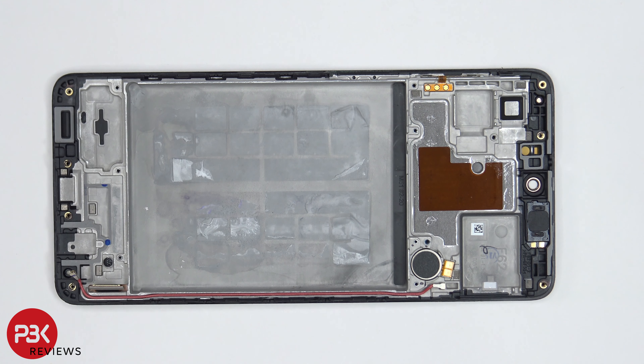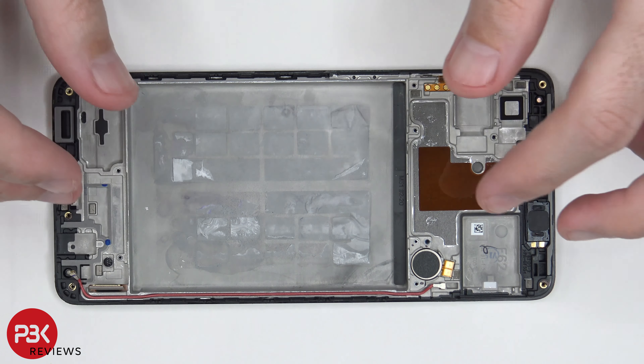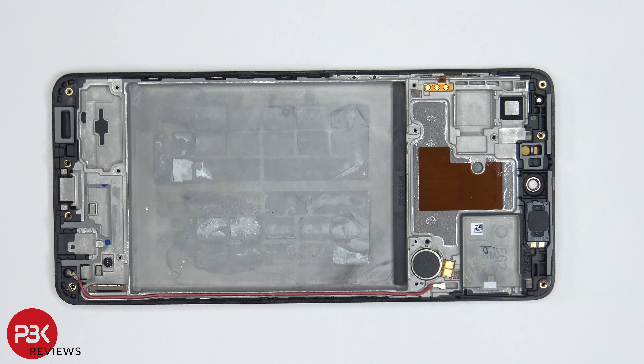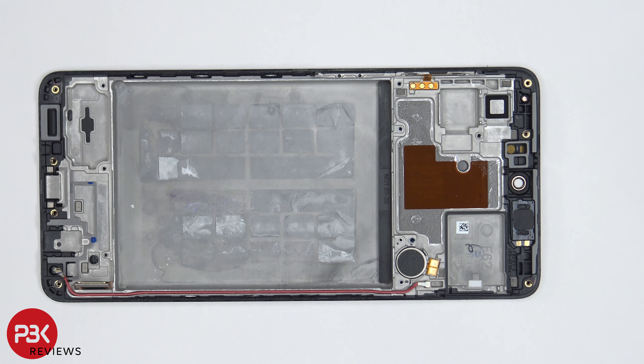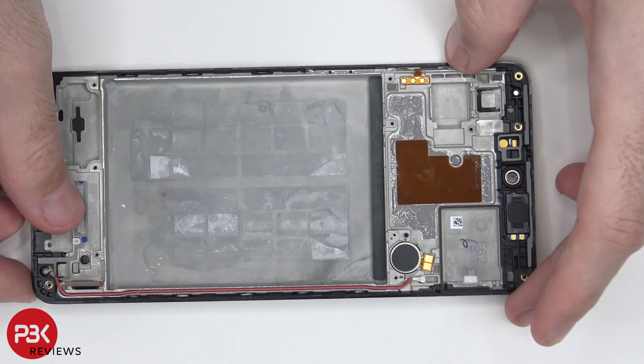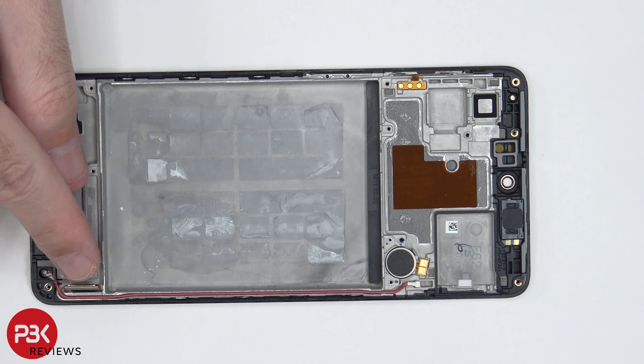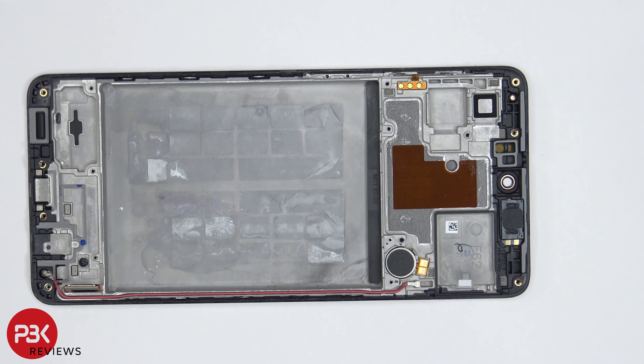As far as replacing your screen goes, you would need to pry off the back plate, remove all the screws, and then remove the back housing. At that point you'd have access to the battery cable and the screen cable on the bottom to disconnect the screen. Most screen replacements will probably come with the midframe pre-attached, so you just take all your parts from your midframe and replace them onto the replacement midframe. If your replacement screen doesn't have the midframe attached, heat up the front of the phone to loosen the adhesive, pry your old screen off the midframe, get your new screen, apply new adhesive, and reapply it back to the midframe, then reverse the whole process.